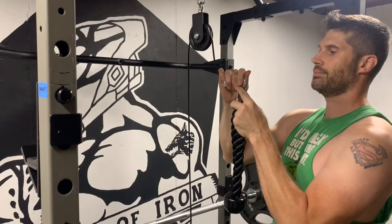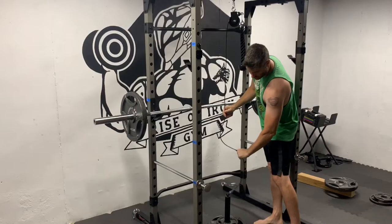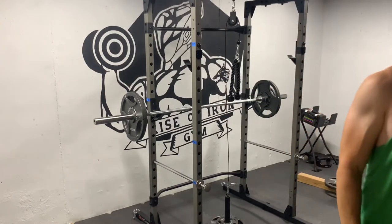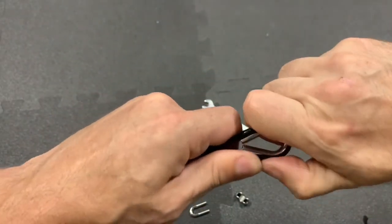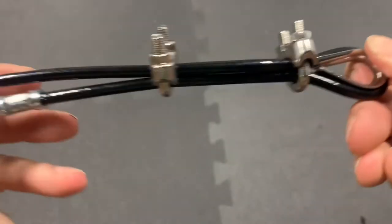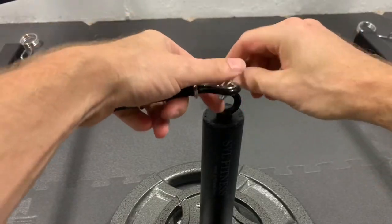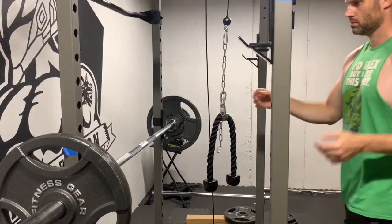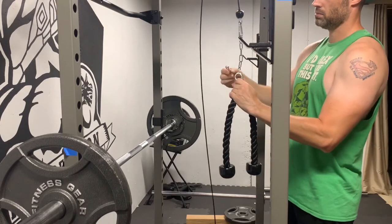The final step is to connect your pulling attachment to the other end of the cable with the carabiner. This cable length is pretty good for me, but depending on how things shake out, you can shorten it with the kit or extend it with a chain. To shorten the cable, install the cable thimble inside, then tighten down the two clamps. Note that this is a one-time adjustment — you don't want to do this repeatedly. To lengthen the cable, install the chain at the desired length. I'm using the stock cable length — no extension chain or cable shortening kit.